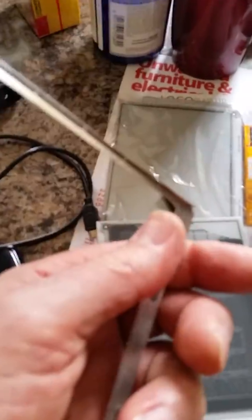On the screen itself — rolling backwards after I've taken it out — there is this stickiness on the front of the screen where the bezel sits. You just gradually peel that back gently. It's a bit fragile, a stainless steel kind of thing, but it quite easily peels away.